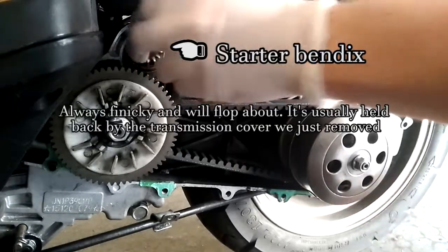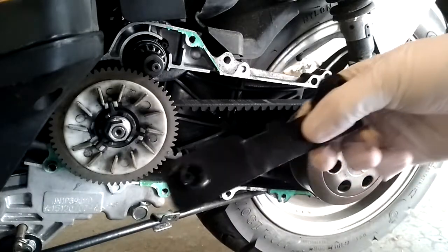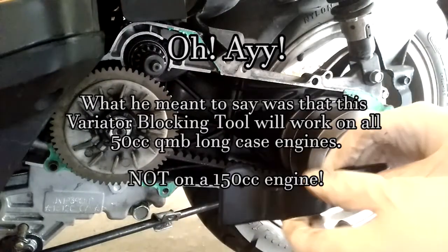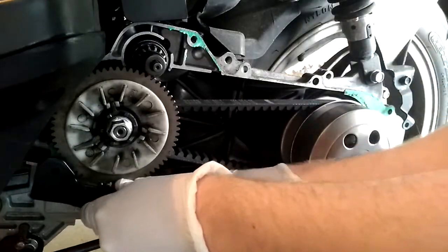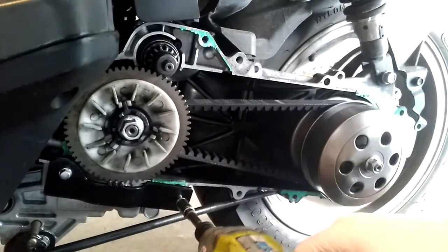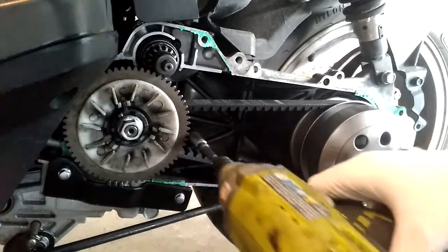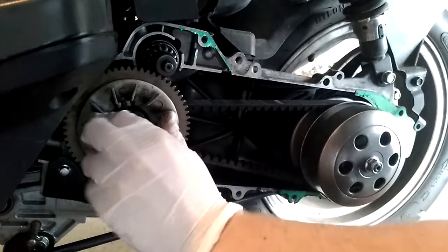Now you get the cover off. Let's block this guy. This is the holding tool you can get — they're all the same for these long cases. You want to take two of your screws and basically just do this. Once you get it started by hand, you can just snug it with this. Just snug — nothing more. Now that's not moving anywhere.